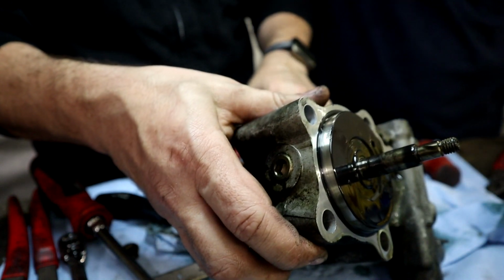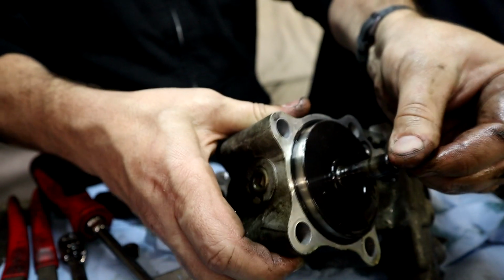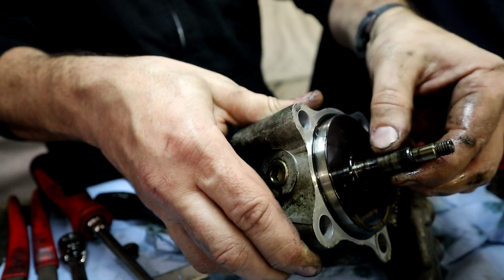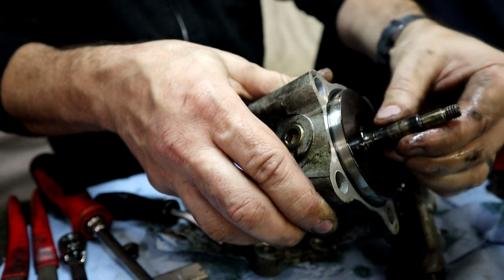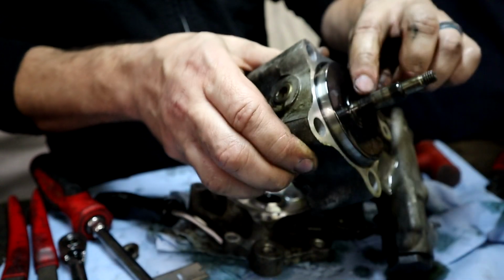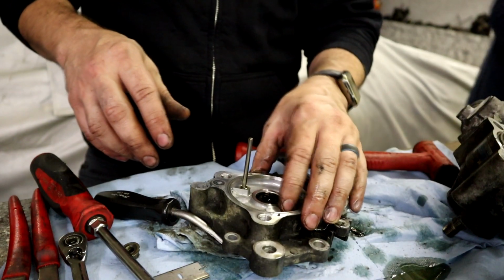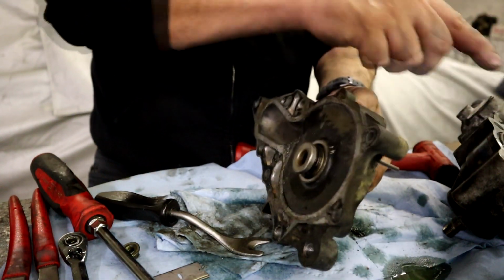Right, I think part of this seal is wrecked, and I think also the seal where it rode here, you can see that there's... I just hope that the shaft is in okay shape still. I think that it is. It seems to me like the shaft is okay, which I was worried about, that it had pitting. We're just going to need to polish it a little bit with some steel wool or a Scotch-Brite pad or something, because that is going to be a steel shaft.